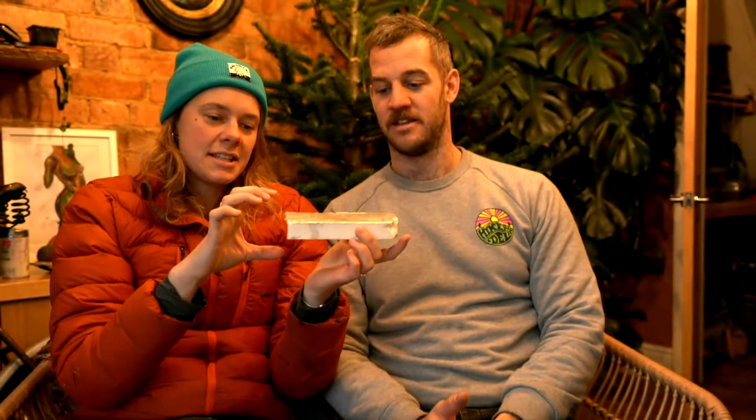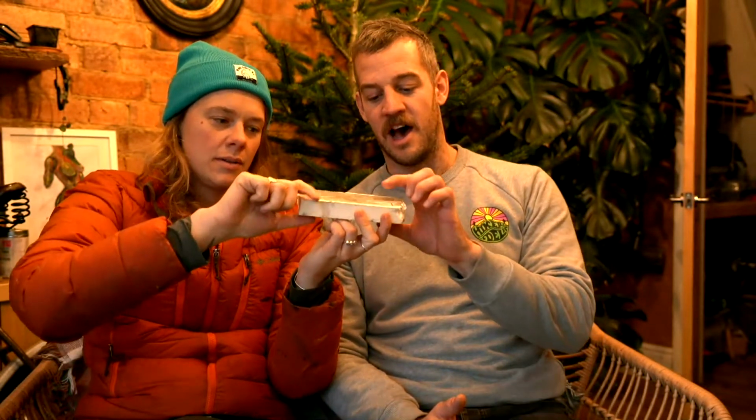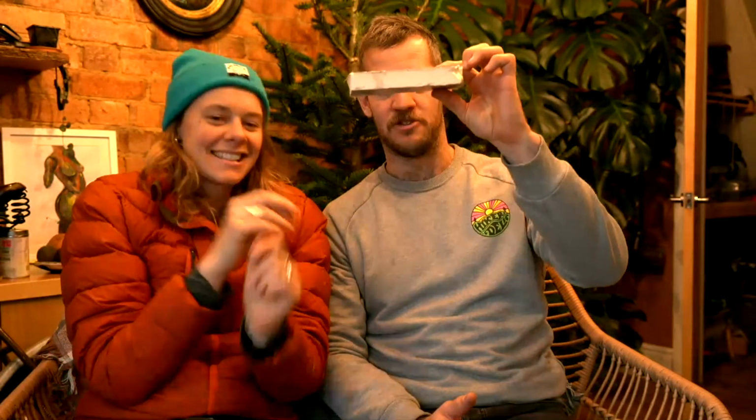So this is basically a dense foam that's really difficult to compress and on a whole, there's billions of little air bubbles in there, which, like we said before, air is what gives thermal property and insulation to things, because air is just a great insulator. So it comes in a variety of different thicknesses. The thinnest we've seen is 25 mil, 2.5 centimeters. Goes up to 40 mil, 50 mil, 100 mil. All of the links to the products that we're talking about as well are going to be in the description. So have a look at them.